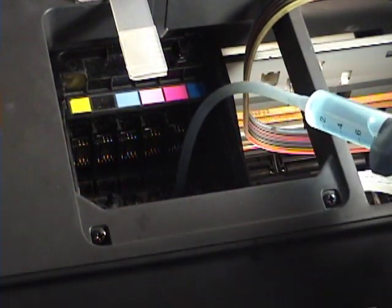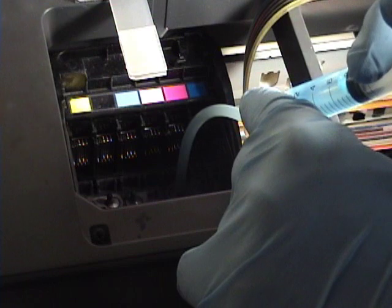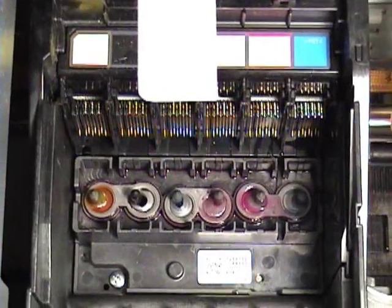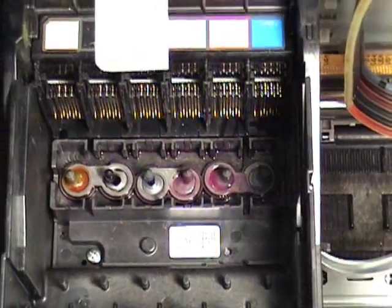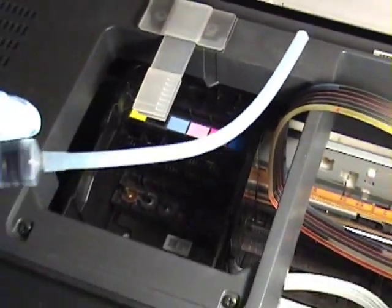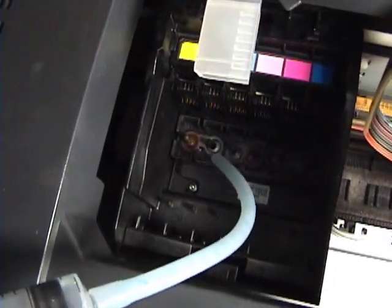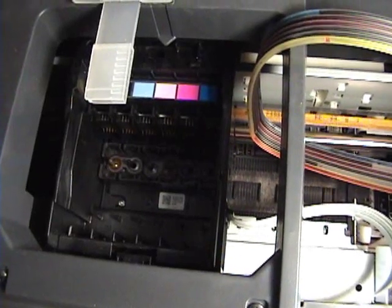While I'm at it, I'm going to squirt actually all the colors, not just the magenta that's sticking. There are little nipples down in there that I hooked a little hose to and squirted the solution. It's sitting over a paper towel. Here's the little apparatus — a little filler they gave me plus the tubing — stuck right down on those nipples. I slowly squirted the solution down in there and let it sit for a little bit.